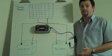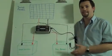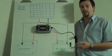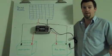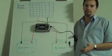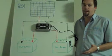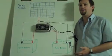It's very different from the rest of the Ctek chargers on the market that plug into the wall, in that it's a DC to DC battery charger. It's designed to charge one battery from another battery, or a dual battery kit. It does, however, vary a lot from our standard dual battery kits that we see in our vehicles. It doesn't just join and disconnect the batteries as required, it individually charges them.